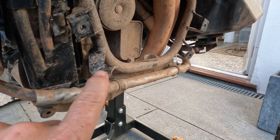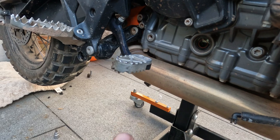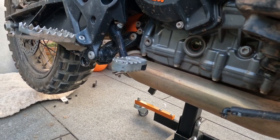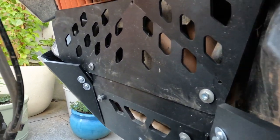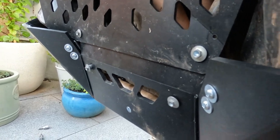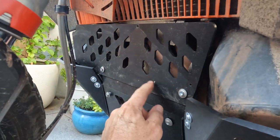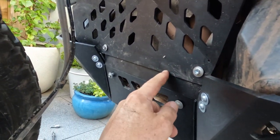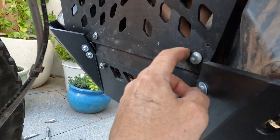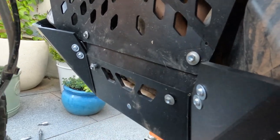I think the way I'm going to do it — I'm going to attach these two first, and that way it'll hang the bash plate under here so I can get the supports in better. It's probably a good job the camera wasn't on — there was a fair bit of swearing. Just trying to line these up was quite challenging. But I've put the extra bash plate on the outside. On the AXP video it shows you go on the inside, but I think there's not enough tolerance — not enough room. So it seems to fit very well on the outside.